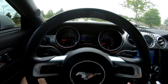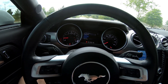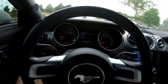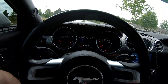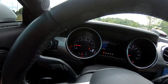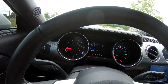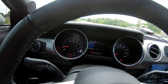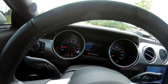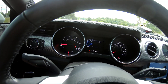Now that you've found your correct tire pressure and your traction control is disabled, you're ready to race. Next, find the correct gear to start in — this is probably the single biggest factor in getting a solid roll. You want to be in the lowest gear possible while still having a little room for your RPMs to move up. For example, my car redlines at 7,800 RPMs — I don't want to take off at 7,400 because that's not productive, especially in a manual where you'd immediately have to shift and slow yourself down.